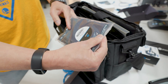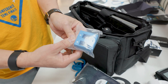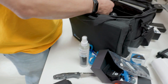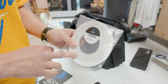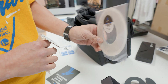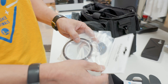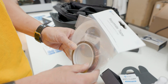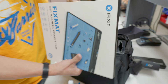We saw the suction cups. You get a microfiber cleaning cloth, and a magnetizer/demagnetizer for your screwdriver. Also in the toolkit you're getting two-millimeter double-sided tape — iFixit said this is a very popular tape that most OEMs use to build tablets, phones, and laptops, so that's pretty handy. It's in a spool, two millimeters wide. You're also getting some generic polyimide tape, which is basically high-temperature Kapton tape.